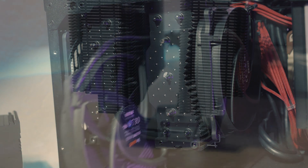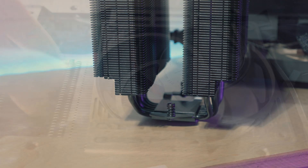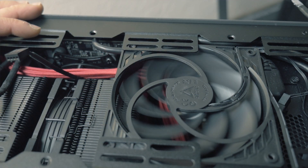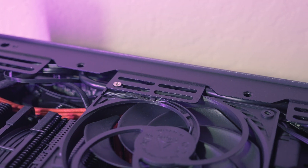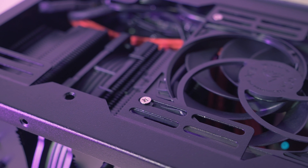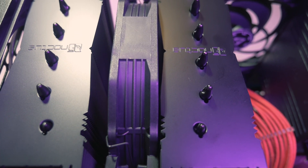Moving on to the D15S, it's a slightly different story. That extra centimeter of space isn't on its own enough to allow a top fan with this board, but it's close enough where you could slide one in, though the blades would typically see interference during operation. The easy solution, at least with higher CPU socket boards like the Gigabyte and MSI boards, is to just slightly bend the heatsink downwards ever so slightly, and there is enough room for that fan at that point. With an ASUS board, you likely won't have to do that. The mounting rails for the fan don't extend all the way across in the S620, so I could only secure it at two points, though the fan isn't really going anywhere given what's underneath it.